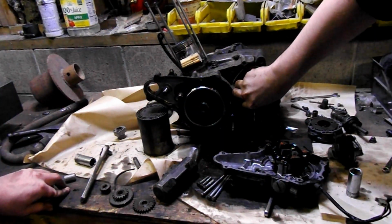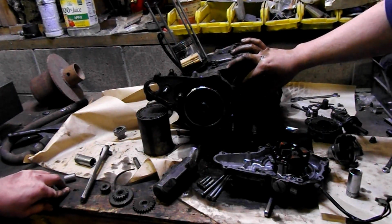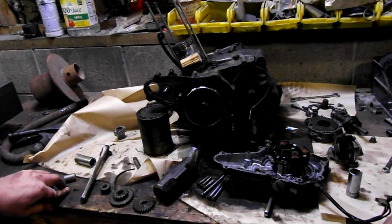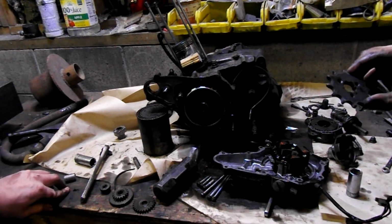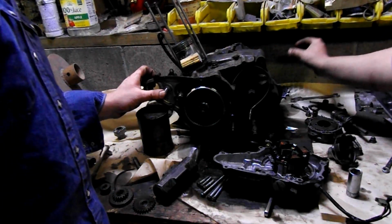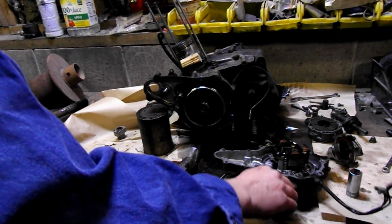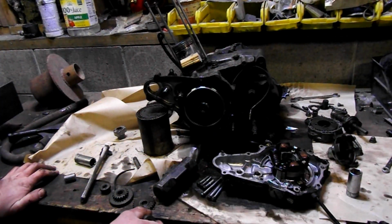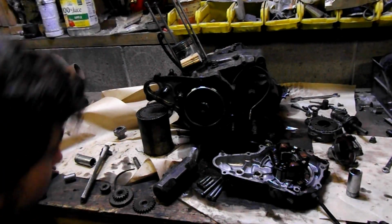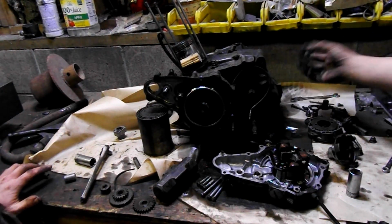Take the front sprocket off when we get the chance. Ours happened to have two of the bolts stripped. We had to hook up a drill to it. Did that off camera so we don't look like fools. Just cranked it and put a screwdriver on the back and pushed them. And once they caught, they came out, except for the one. The one fully stripped itself out. But the bolt is what's stripped, not the threads in the sprocket.